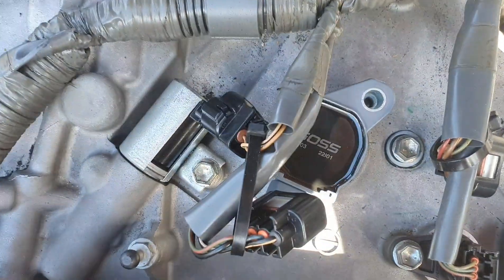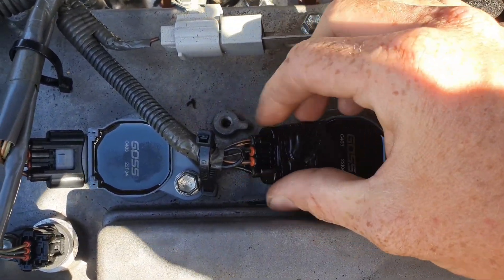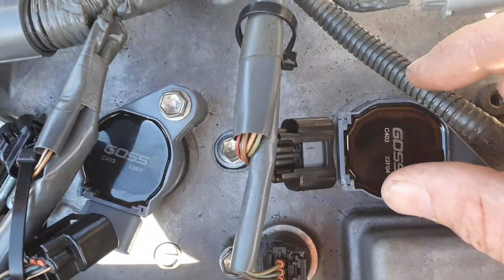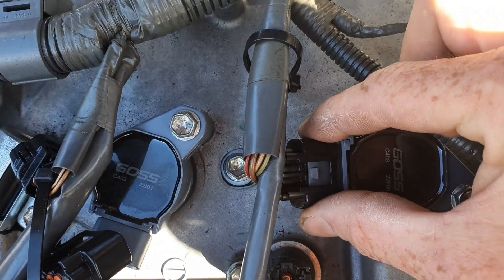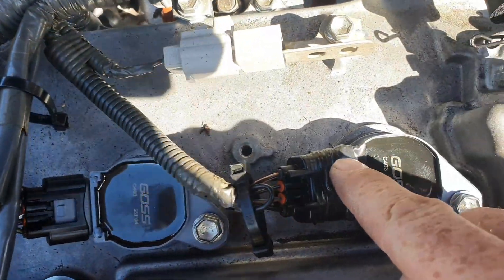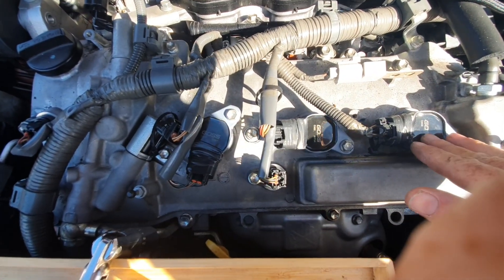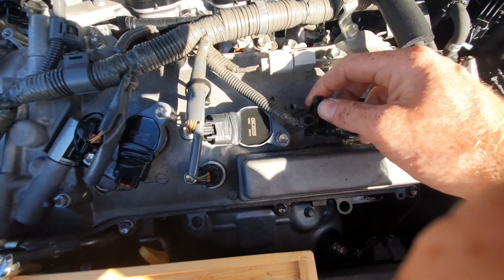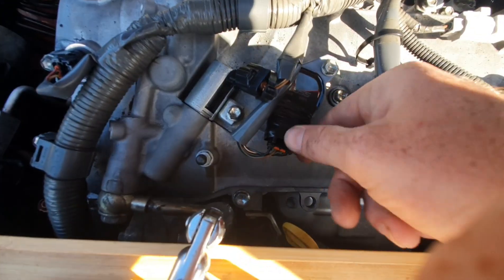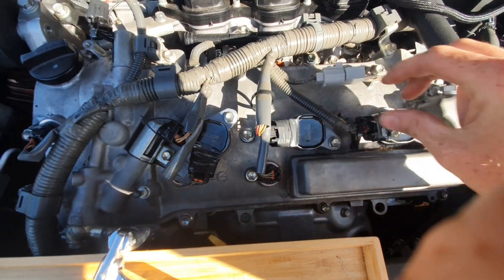She's in. What I've done was I put some electrical tape to keep the connection to the coils more firmly, because the actual clip over time has snapped off. If I'm going 100km/h on the highway over rough road, that will usually move and disconnect from the coil. So just as peace of mind, I put tape around it to give it more stability. I've got all three new coils installed for cylinders two, four, and six. Toyota uses zip ties to secure the connection on my old coils, which clearly did nothing — so the tape is nicer, everything's nice and strong, nothing loose.